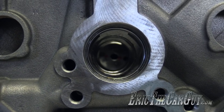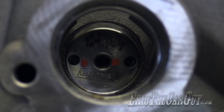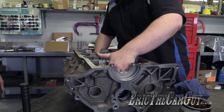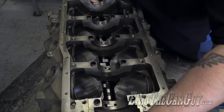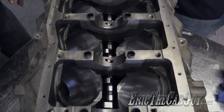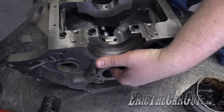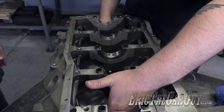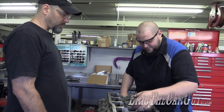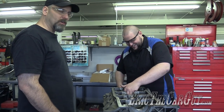I'm surprised you don't have one of those long things that sticks off the back. I've got a bolt — works good. I use a bolt too, but I'm surprised that my method was machine shop worthy. I already spent $600 on a cam bearing tool; I ain't buying another one. Sometimes you just need to pick and choose. There's a rotating camshaft — that looks successful. What locates the back — is there a bushing or just a plug? Just a plug on the back, like a big core plug. Then you try not to gouge it with the lobes, because bearings are soft material and the cam is really hard material — and a little sharp.